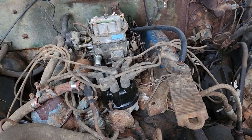We got this thing to where it'll fire up now. This is where I'm gonna ask y'all for a little bit of help — I'm not exactly a veteran at tuning carburetors. Whenever I set these mixture screws after I freshly rebuilt the carb, I had them set two turns out. After putting on the automatic choke it idled for about 15 seconds pretty good. I was really excited, but whenever I opened up the choke a little bit more it immediately died. So I was thinking if I add air to it and it dies, it's not getting enough fuel.